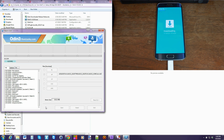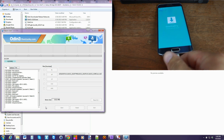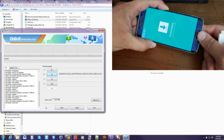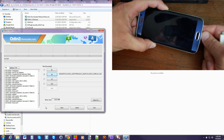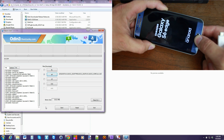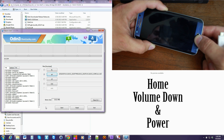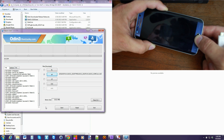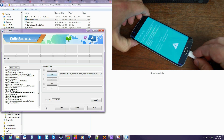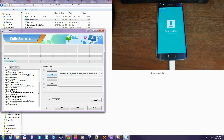If you consistently have problems, another thing you can try is hold down power and volume down — eventually it is going to reboot. Then hold your same buttons to get into Odin mode again, which is going to be the home button. We'll do it one more time here. Go ahead and plug the device back in, hit volume up, and see if this will get the device added. Let's go ahead and hit Start — there we go, that time it is looking much better. Everything is running.